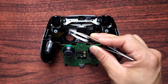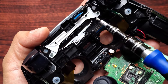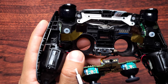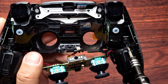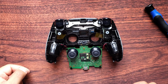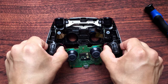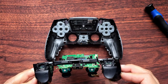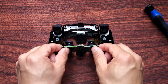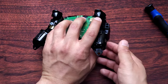If this piece comes out of your controller, remember how it's placed — it's always good to remove it and keep it safe. There are two silver screws you need to remove, and two black screws — one on the left side and one on the right. Once that's done, grab onto these two ends, pull it towards you, and the whole internal casing is off. Now flip the motherboard over again, then flip the whole casing over.